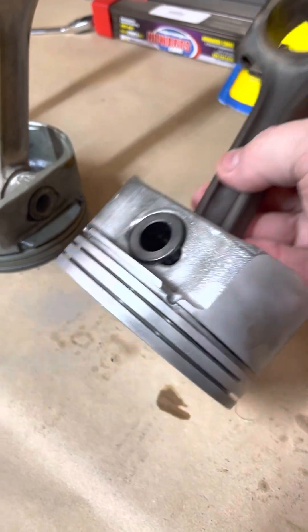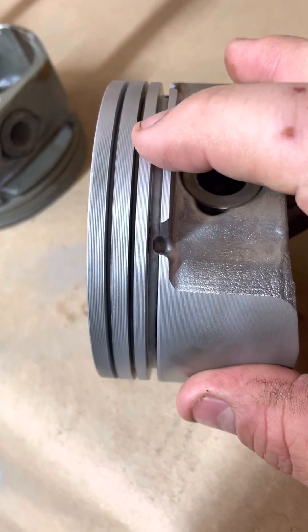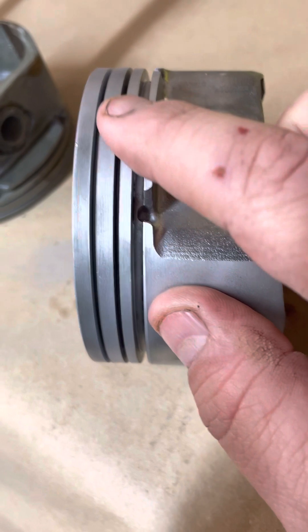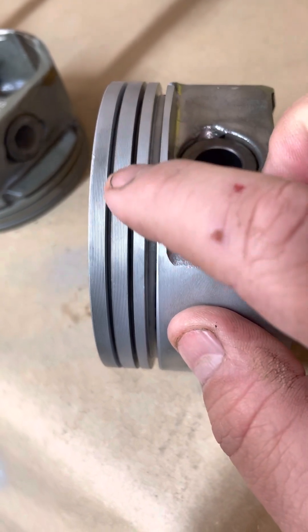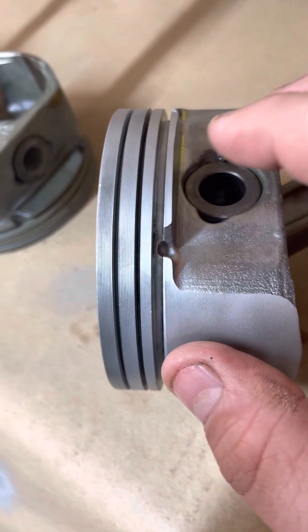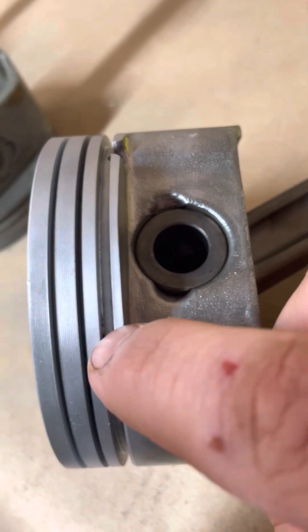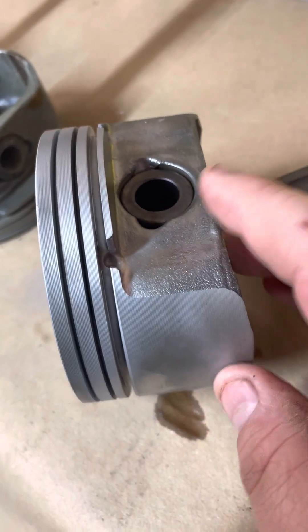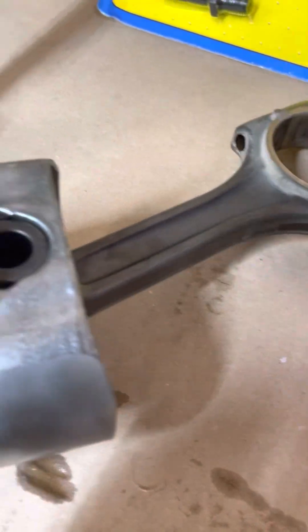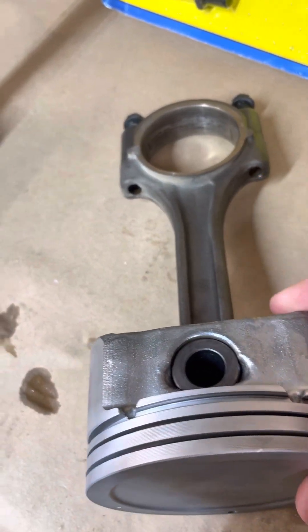You have to be really mindful of the dimensions of the piston ring lands — these things aren't really flat. So if you go in there with a carbide scraper and clean that out, or hit it with a dry blast or even glass bead, it'll change that dimension a little bit. Then I have to worry about contamination — did I get all the glass bead out of the oiling holes? Any abrasive material left is a no-go; that's a big deal. With the wet soda, we don't have to worry about that. We just soak it in water and it dissolves all that and it's gone.